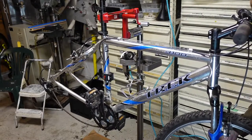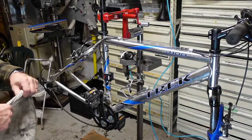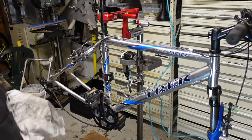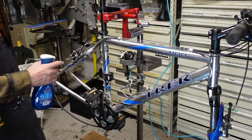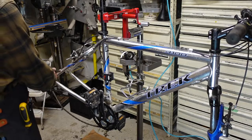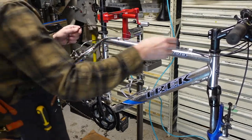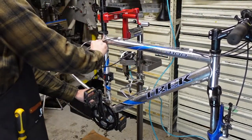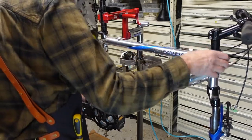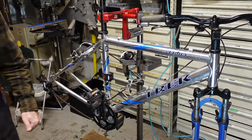I'm taking the front wheel off off-camera, just because it's not that interesting. Then we'll go through our initial cleaning sequence. This one — you saw how dusty and filthy it was — I'm going to start with some good old fashioned Dawn Power Wash. One thing you can do to make it easier to clean is push in the rear derailleur; that's a good way to release the tension on that rear derailleur cable. You can do the same by pulling on the front one to release the front derailleur cable. With the brake cable already loose, you get all your cables off and now you have access to the whole frame, which makes cleaning a little bit easier.